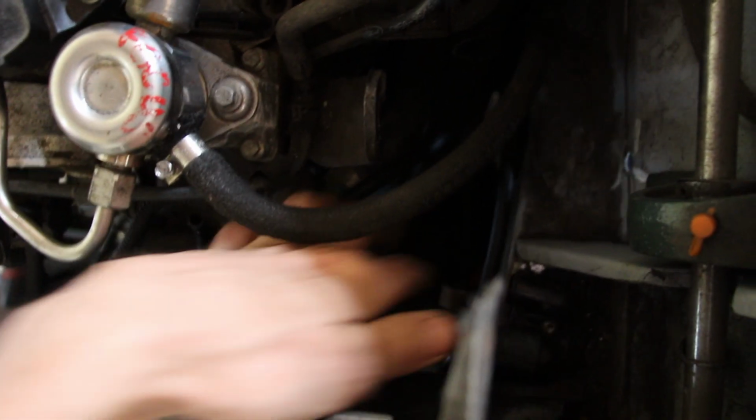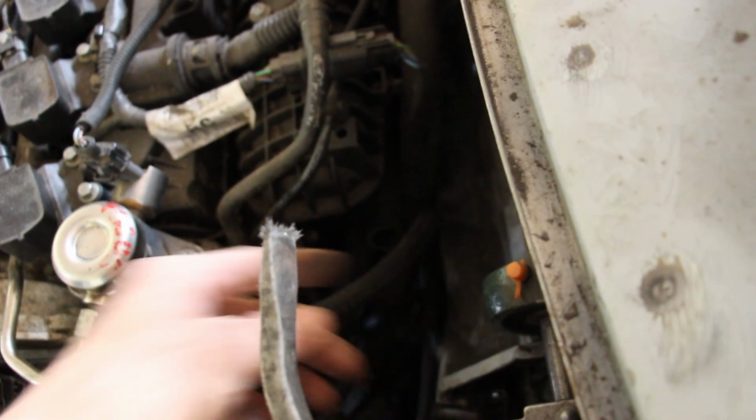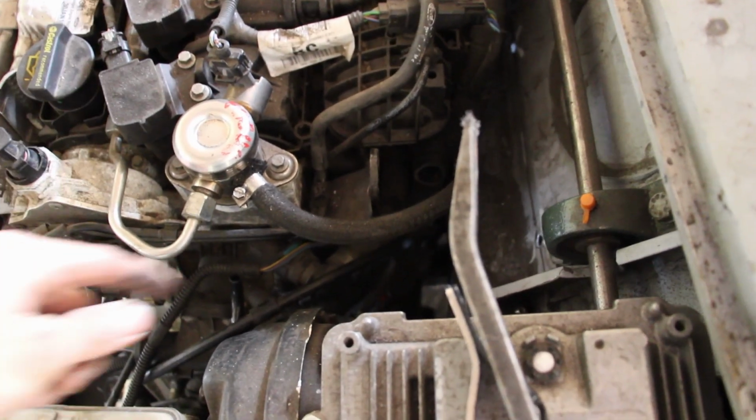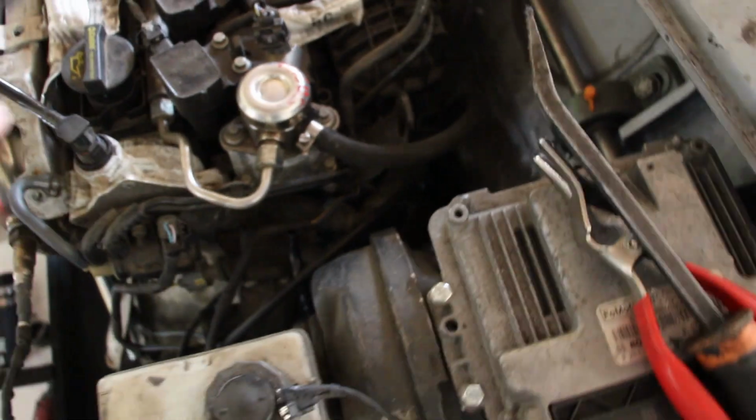We'll work out the little pipes here later. One matrix pipe runs directly across. It's very nice. We'll have to put a little standoff here just so it doesn't rub through. And then the pipe that comes up here, you can't quite see it. Maybe you can if I do that. It's in there. That comes from the exchanger. It comes from the oil filter. So it comes from the head to the exchanger into the matrix and then back into the system.